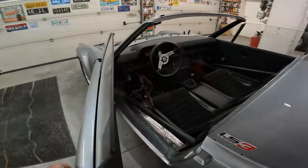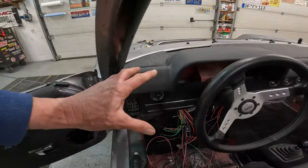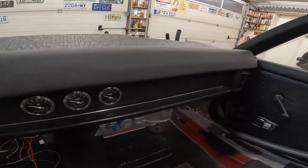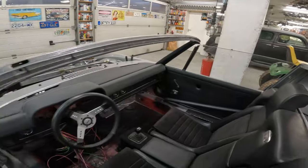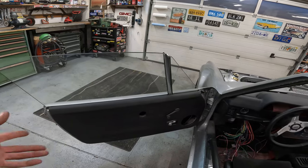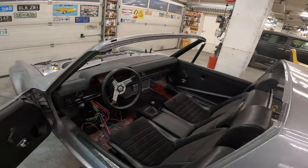I've got the windows installed. I haven't got everything done completely yet, but I've got the dashboard in there — it's just placed in temporarily. That's what it looks like right now. Looks pretty doggone cool. The door's over there, so everything rolls up and down, the mechanisms are in there. That took a long, long time because, as you know, 70 and 71 door innards are different than 72 and later. Big, giant problem, but I think I've got that solved.